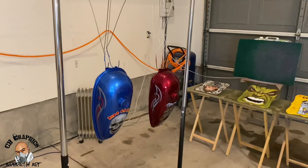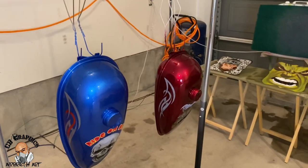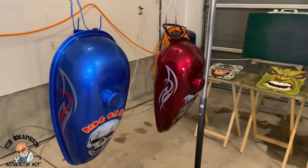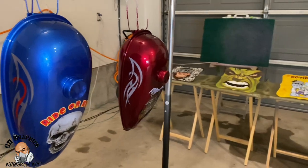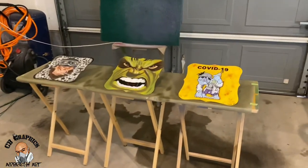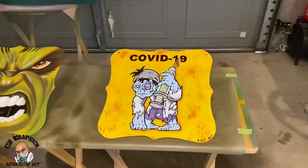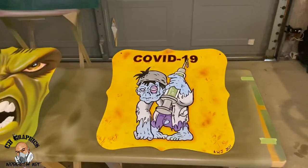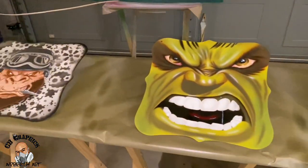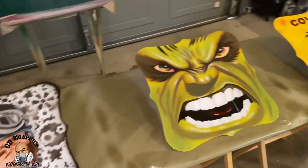This is 30 to 45 minutes after my last spray. I got both of my heaters turned on, which has the temperature close to about 90 degrees to help the tanks and the panels cure a little quicker. We're gonna go ahead and let it sit for 24 hours, come back tomorrow, unmask the bike gas tanks, and take a look at how it looks outside and under the LED lights.